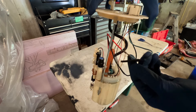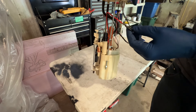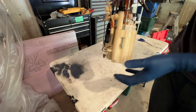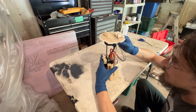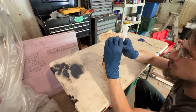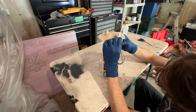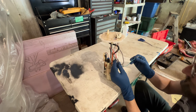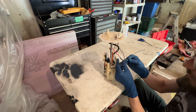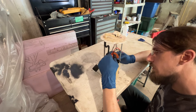Right here — the heat shrink for this connection is definitely messed up. That's a potential short right there, which is pretty significant. Another thing that had me concerned was this loose connector here for the positive terminal. Yeah, that loose connector right there is coming from the positive. I'm going to try and squeeze that and also do new shrink wrap. Let's do the level sender too.